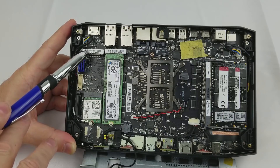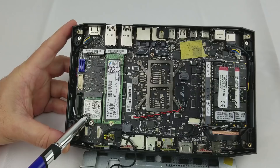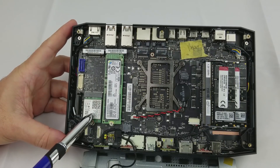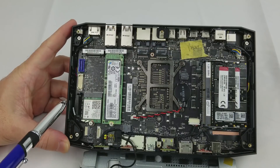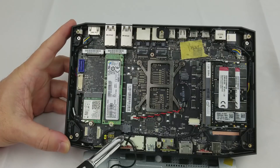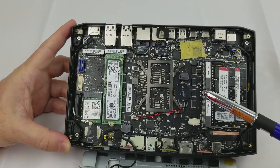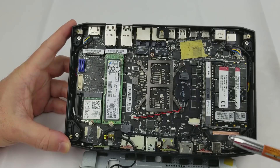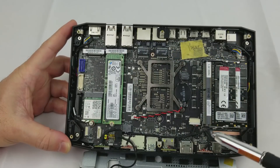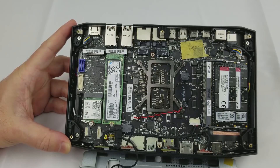This is the secondary M.2, which also supports PCI Express or SATA. This is the 8265 radio — 802.11ac plus BGN — commonly called gigabit wireless. It supports 867 megabits per second of communication in a two-by-two array. You can see the functional lid connectors exposed here. These other connectors I'm not sure about — I might cover them in the future. You can actually see there are two sockets here. These are the BIOS and the embedded controller firmware sockets — this is a prototype where they could take those chips out, program them, and put them back in before they developed the code for in-place BIOS updates. You can see the magnetics for the two RJ45s, the four microphone plates, and the cable harness. That is an inside look at the new Hades Canyon.